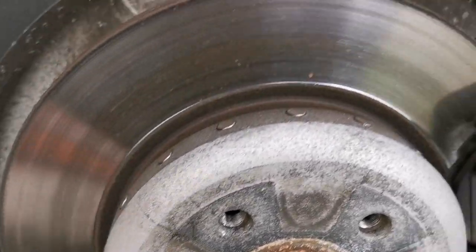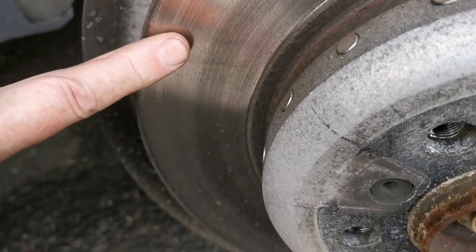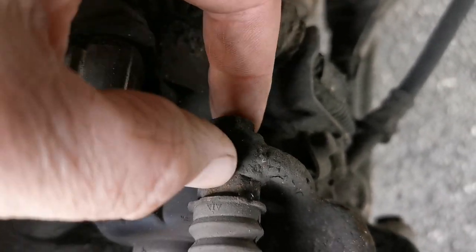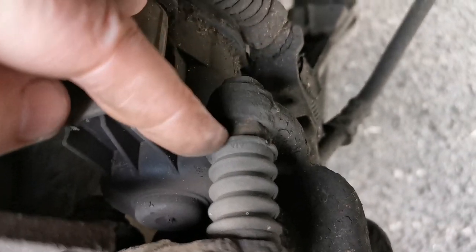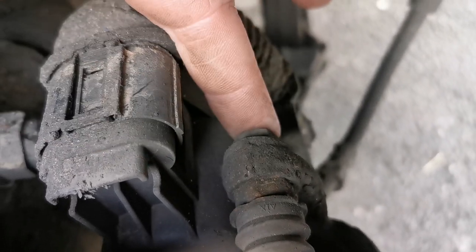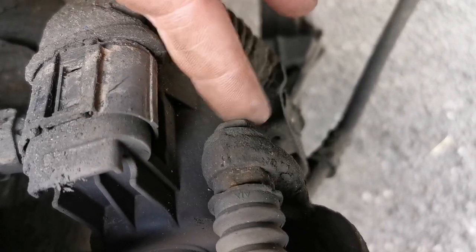Now at the back wheel — taking the back wheel off with the winter tyres. As you can see the rear brake pads are worn right down with nice even wear, and luckily nothing scored on the disc — nice smooth finish with minimal lip. To remove the caliper you undo the nut at the back, which is 15mm on the outer retaining nut and 13mm at the back. You can hold it with a pair of pliers or a ground-down spanner.